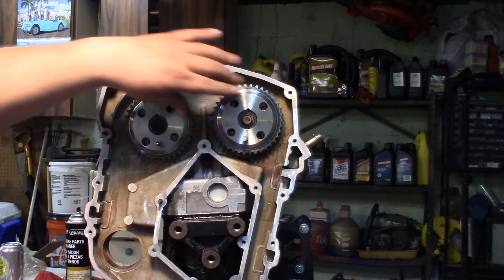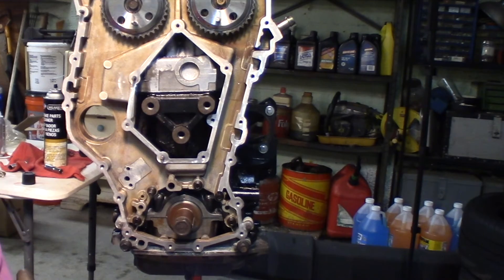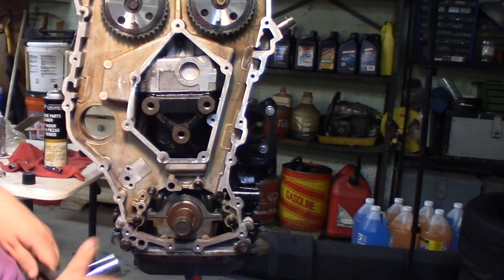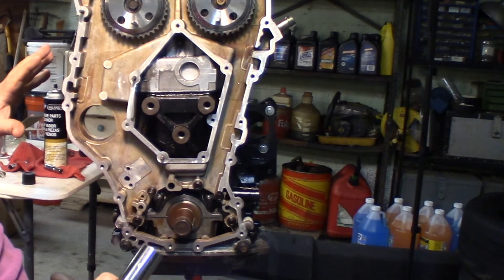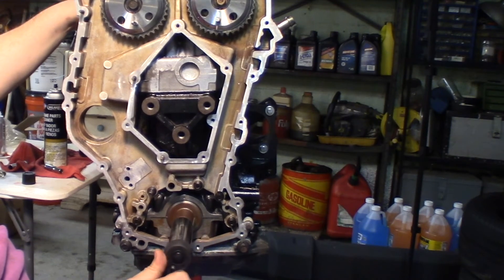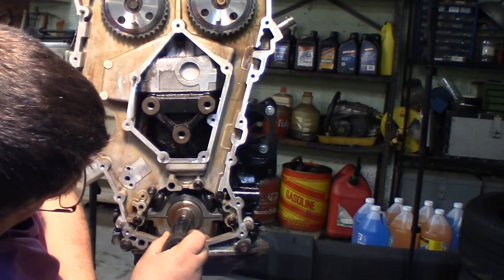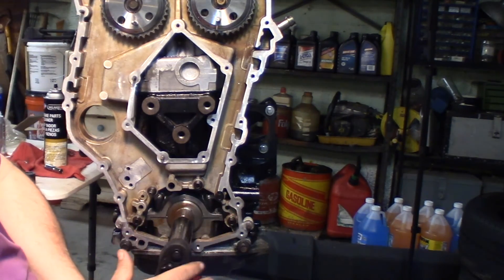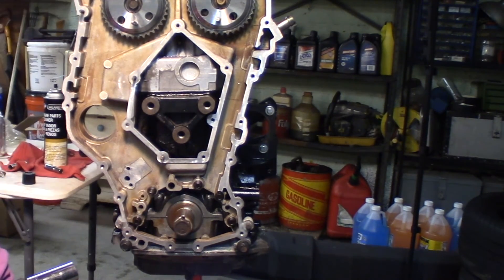All right, so now those are pinned and in place. We can slowly bring our crank back around to the top dead center position. Under here there's a little dot that this keyway pin needs to line up with. These are pinned, but that doesn't mean you can just go spinning the engine over all willy-nilly right now — because while it won't hit on one or four, it'll still hit on two and three. So you just want to bring this back to where that mark winds up, nice and slow. If you feel any resistance, stop because you've done something wrong. Now our pistons one and four are at top dead center, and we're ready to go ahead and proceed with the timing chain installation.